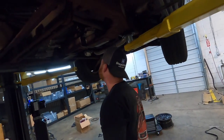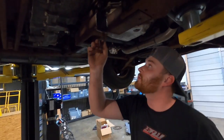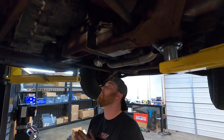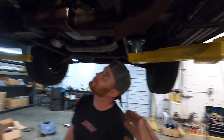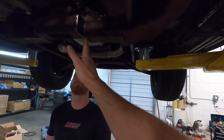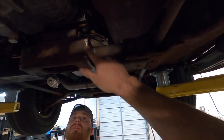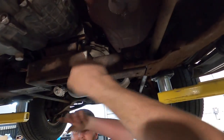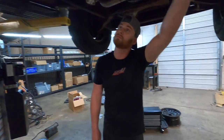I didn't get to see this yet — the crossmember mod. Is that a straight piece? Yeah, straight piece. Because the saw blade kerf — as someone in the comments told me it's called — is an eighth inch thick. So I got the same thickness metal and it just fit right in there perfectly. I didn't weld this entire back piece, I just kind of tacked it and cut it, but it looks good.